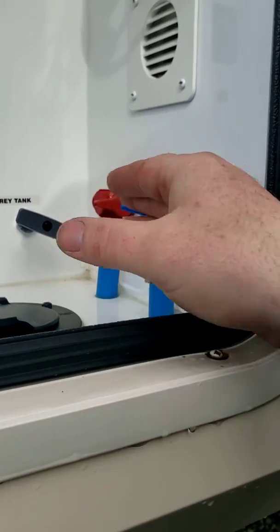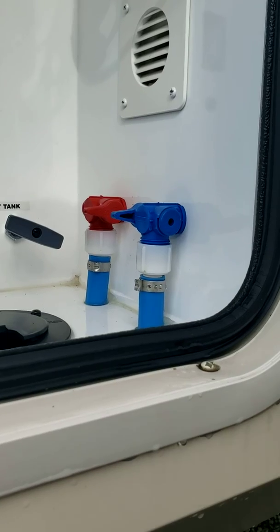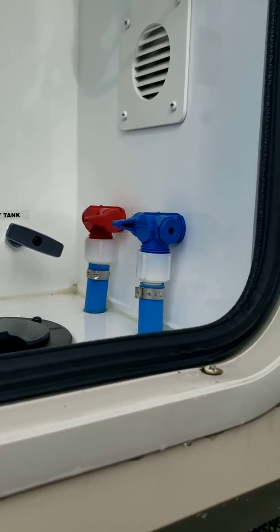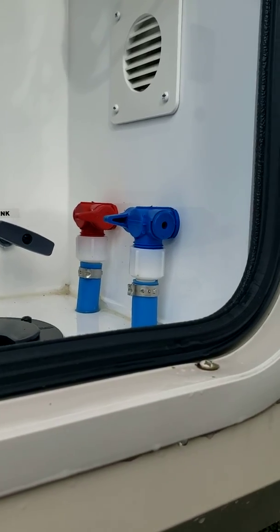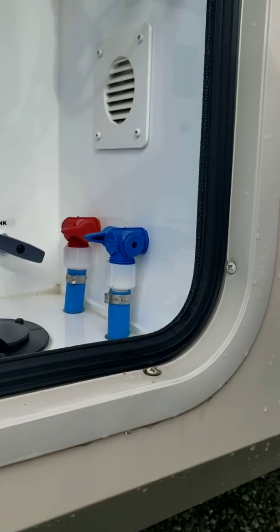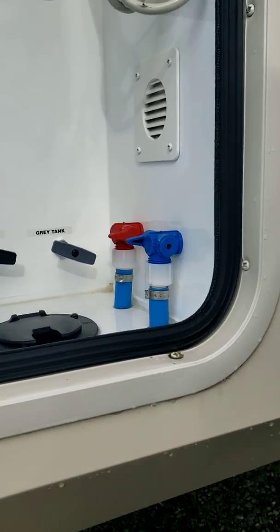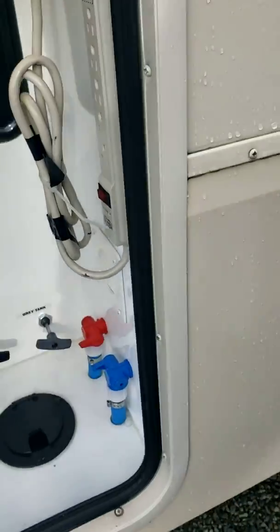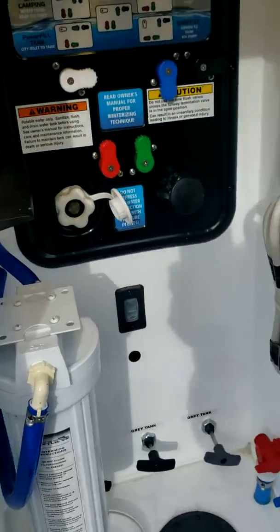And when I do that, as well, I go inside and I turn all the faucets on in the unit, and then I come and crack these, and then I go back in and I flush the toilet just to make sure all the water is out of the system, because just because you pop these, there might be a bit of a vacuum in it that's keeping it from draining. So just make sure you go in and drain all the water out of the lines.